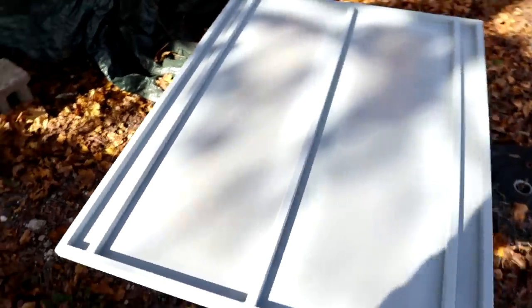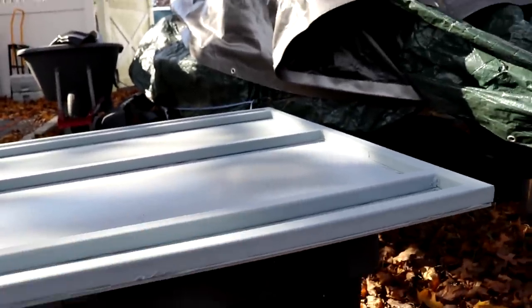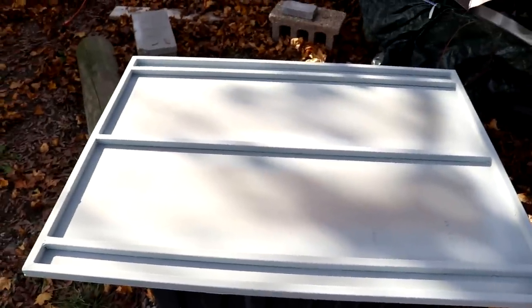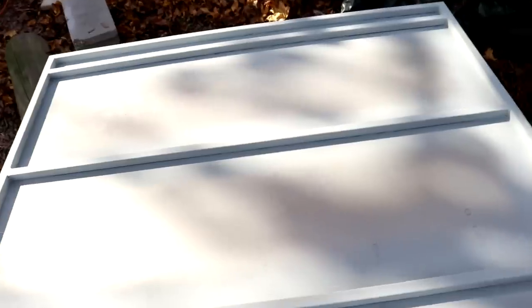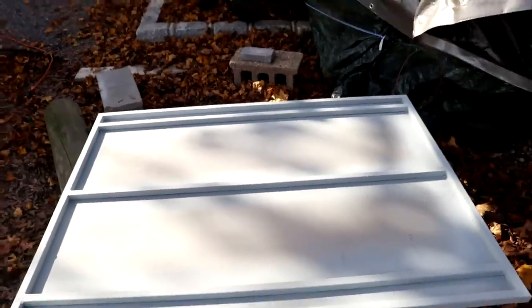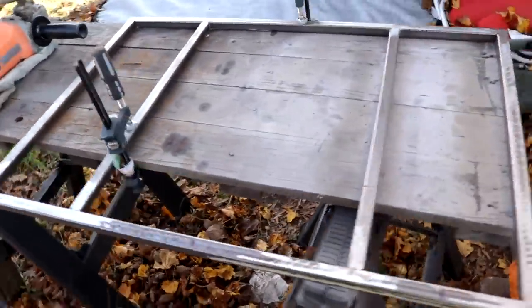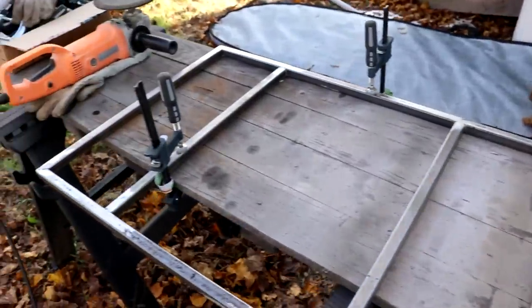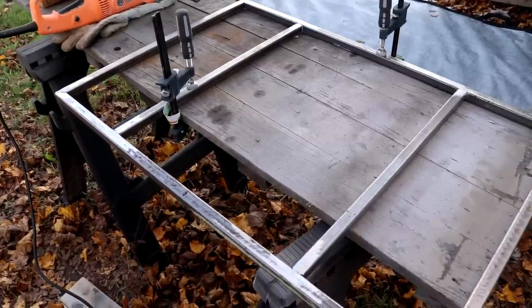Here's the rear door — it's primered, and you can see that's the aluminum skin on the outside. I still need to sand the edges, and then they're good to go. We're going to cut the holes for the latches and then put the hinges on. Started early this morning grinding the welds. We're going to clean this up and skin both doors. No more grinding away.